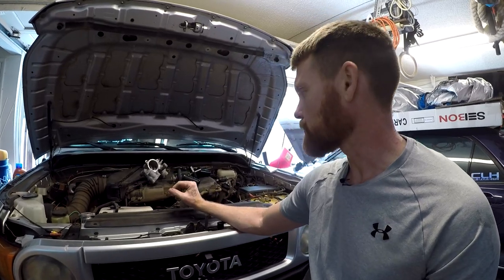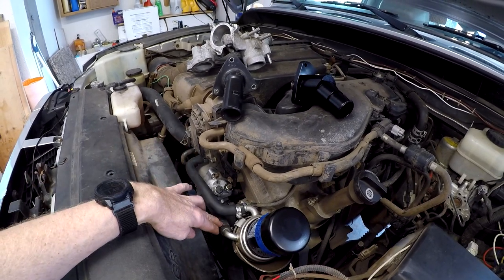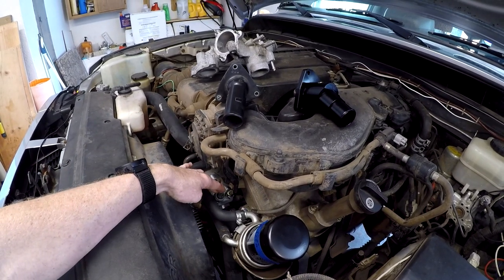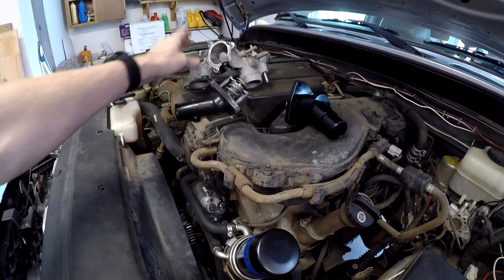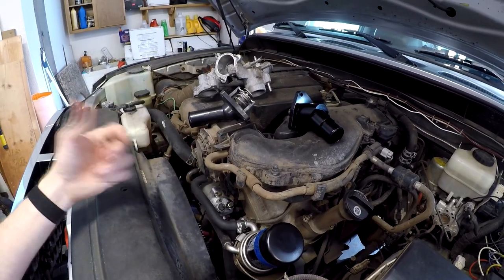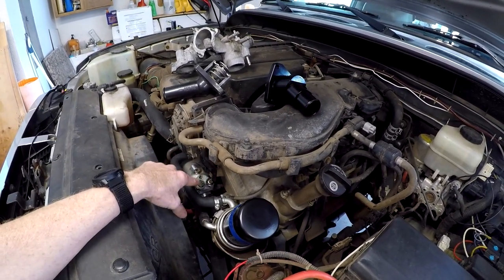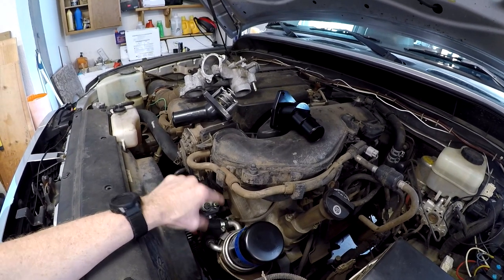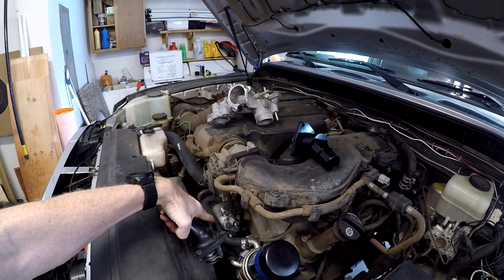Toyota just makes amazing stuff. To do this install you have to drain the coolant from the system. Because I have this tow package from the Tacoma mounted on the FJ Cruiser, I've got to remove those lines to get them out of the way. These are just sensors I'm using as plugs. I'm going to put the studs back into the housing because it's easier to get the nuts on — that stud on the inside bottom closer to the head is the most difficult one to get. It's a very straightforward install; you don't need to take out the fan shroud.